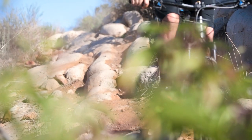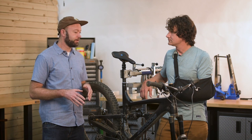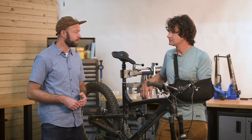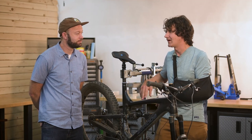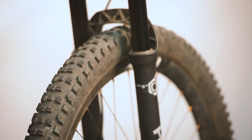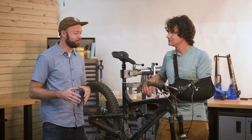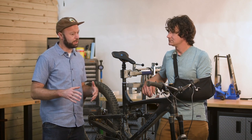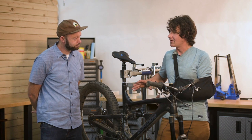I noticed how low the weight felt — almost like an even lower bottom bracket with the mass centered. It's a steadier, less poppy, less playful bike. That lines up with a spec change we made: out of the box it comes with 2.4 or 2.5 tires, but we put 2.8s on it. With a little more centralized mass it seemed like a bike that really benefits from more tire, playing to its strengths of getting through stuff.